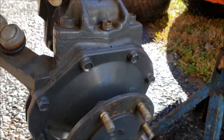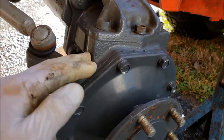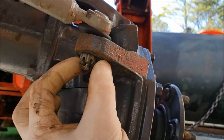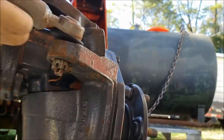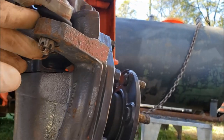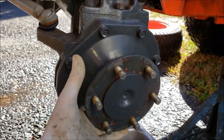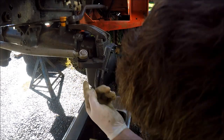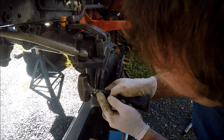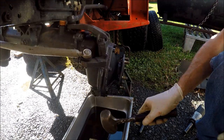In a nutshell, the way I'm going to go about it is remove these two 17s, this 14, and get this bracket off. Get your inner tie rod end off — looks like a 17 millimeter on here. Once you loosen this, you're going to hit this with a large hammer, but going toward the control arm so you don't break anything. And a 14 mil to drain the oil out. Then remove all these 14s and pop this whole cover off. To get this tie rod end off, just hit it right here — enough to get it off.